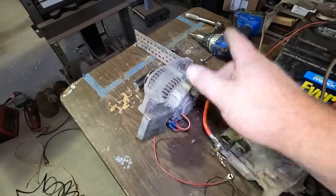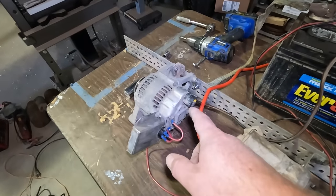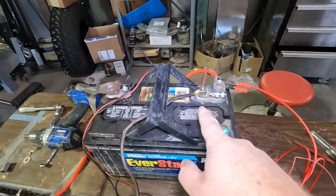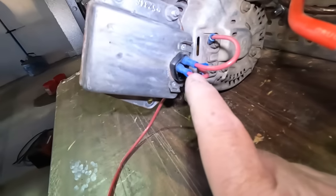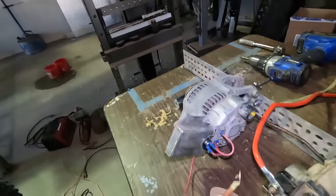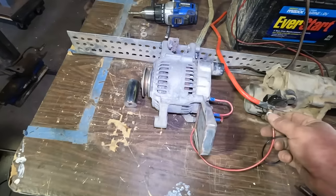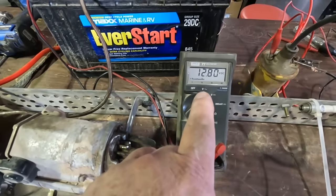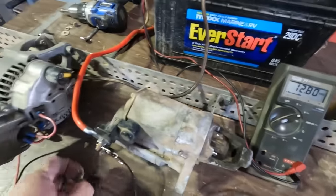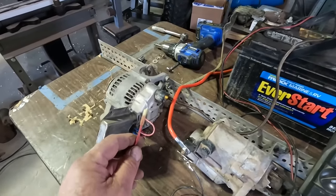Generally in an alternator, you have coils of wire that are stationary and coils that move with the pulley. You put electricity through one set of wire, and moving past each other it actually creates voltage, which then goes through a big thick wire to your positive terminal. You have to get electricity to the alternator before it produces juice. In the case of the Mopar regulator style, power goes to the center pin — we basically just hook up 12-volt power and that energizes the coil and creates a magnetic field. It's drawing power the whole time, so this field wire needs power that is switched only when you want that alternator running — when the ignition is on.